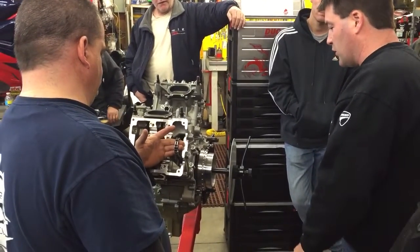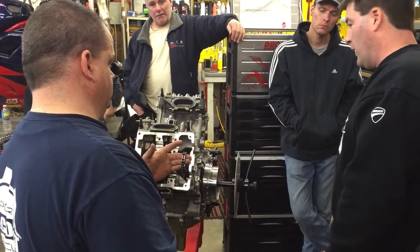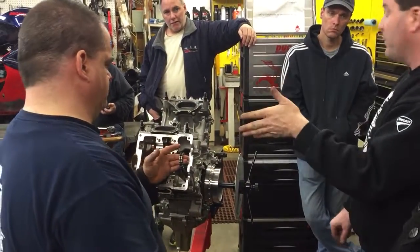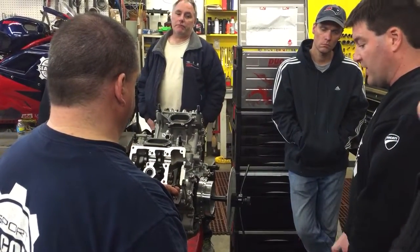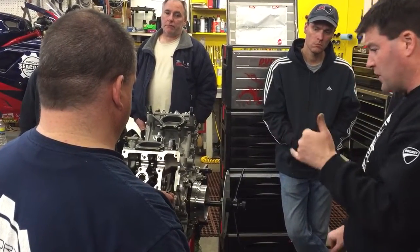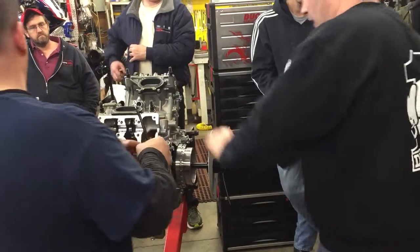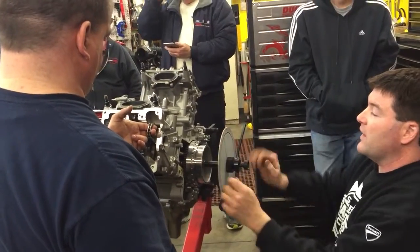With that motor, technicians learn early on you have to do it exactly how they state. Ducati gives you two ways. We put it at any top dead center in the back, locked it down, and did our rear. Now the one we picked for the front is very important — the specifications say 450 degrees of crankshaft revolution after the rear is timed to do the front. Sean's going to pull the crank lock out of the other side and free the crank up. We've got our degree wheel; I'm zeroing it out to this dowel pin or set screw, so we're going to go 450 — which will be one revolution plus 90 degrees.